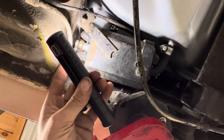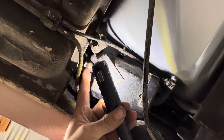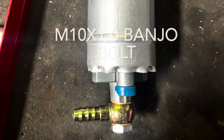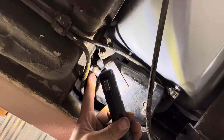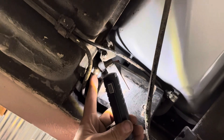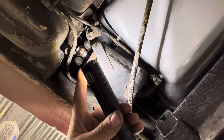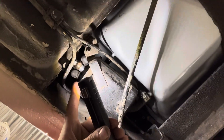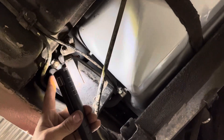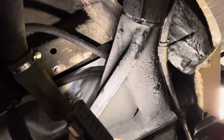This is a stock Mark 1 pump. I used an 8mm or 5/16 banjo barbed fitting — I'll show a picture of that as well. I replaced the stock Mark 1 outlet on the pump with this banjo fitting, which allowed me to go to a soft-style hose. You could use a dash-six if you wanted to go to AN fittings — there are a lot of options here. This is just a stock Mark 1 pump and it will be more than sufficient, even if we wanted to go turbo. I may add a surge tank if I wanted to go to a turbo setup.